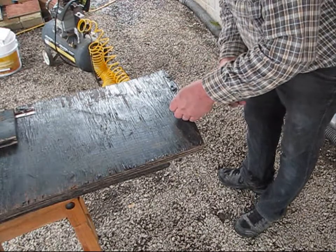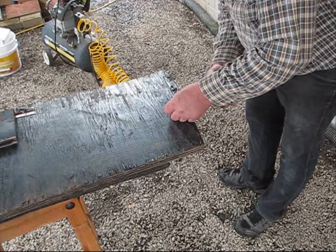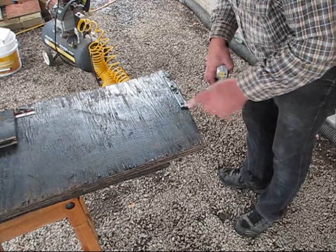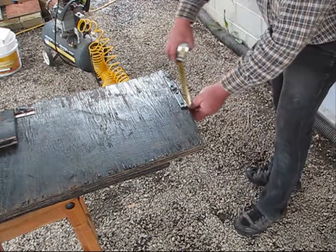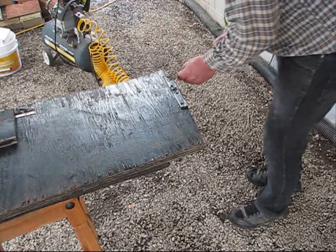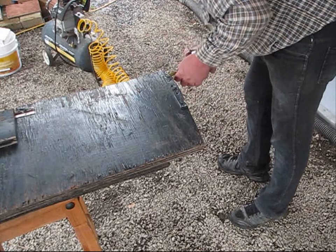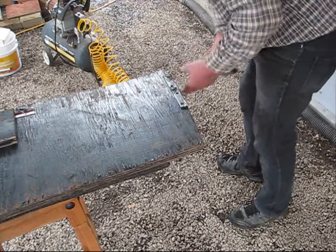So this is the transom piece that laps over the back of the boat on the outside, and this is where your motor attaches. These pieces are about 7/8 inch wide, and they come to be about 8 inches long. The angle iron is about 7 3/4 inches, so your angle pieces are gonna be 1.5 inch by 1.5 inch angle.